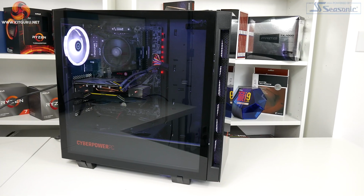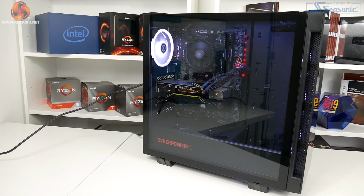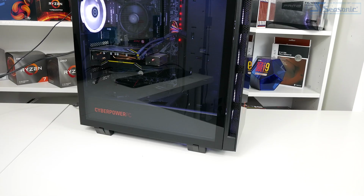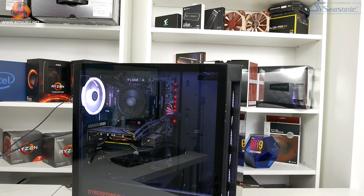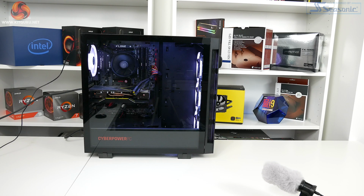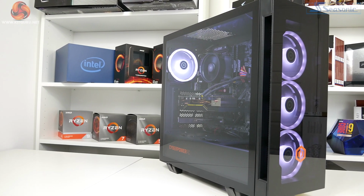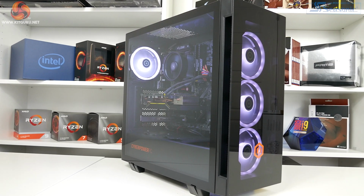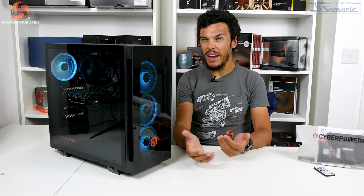Noise performance is okay, but certainly not ideal. Under idle and light load conditions, this is where the noise performance is most disappointing of all. The chassis fans do not spin down as they're not motherboard controlled, and they were therefore clearly audible when they really didn't need to be, as the system wasn't doing particularly much. Applying a CPU load does add some noticeable noise from the Wraith cooler as it ramps up to 2700 RPM, but this is not particularly obtrusive over the chassis fans. The increase in noise levels is just not massive because the idle conditions are quite loud anyway.